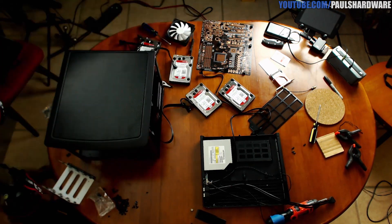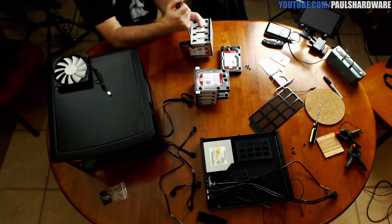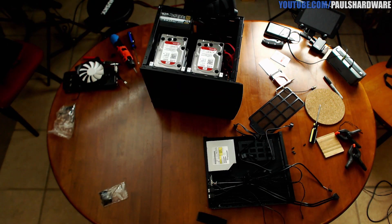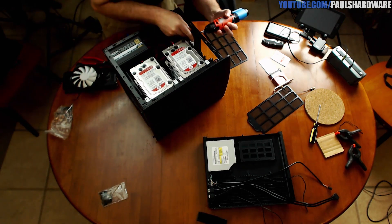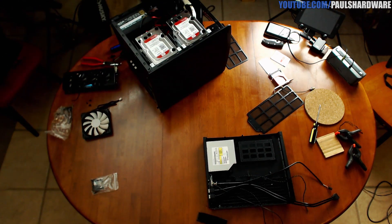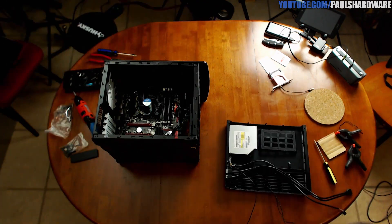It's functional but I think I just need one more adapter cable. Mounting up the WD Red drives now — I was happy with the Node 804 when it came out because I had already had this idea in my head, and the 3.5-inch drive storage on this case is really impressive. I'm only using half of the spots for a 16-terabyte RAID 5 array, which gives me about 11 terabytes of usable space — really sweet. That's almost wrapping it up now; I'm finishing some of the wiring on the front, doing a little braiding on the cable. I like braiding cables — always exciting.